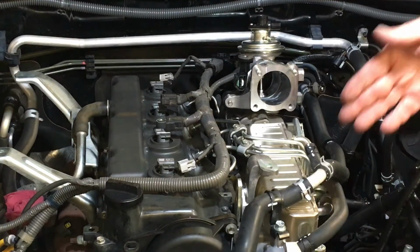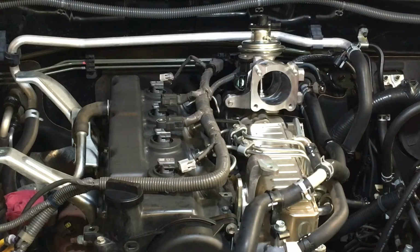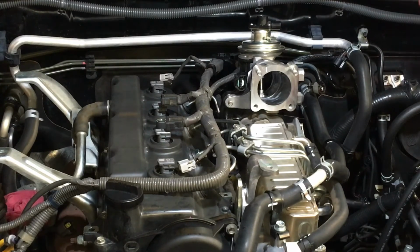Make sure you got your ratchet and your 22mm off your crankshaft. Yep, from turning the crankshaft when you did your valve clearance check, don't forget that. Makes an awesome clunk when it falls off when you start the engine. And it usually undoes the crankshaft bolt, which is meant to be 325 Newton meters or something like that, which is fun tightening it up again. Done that a couple of times. So I can tell you what I've done.